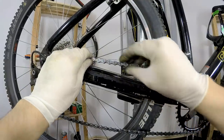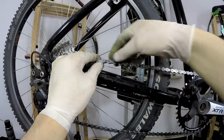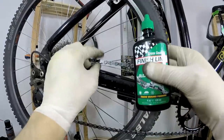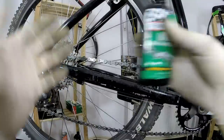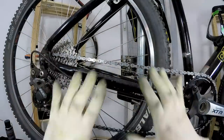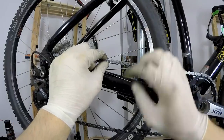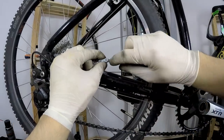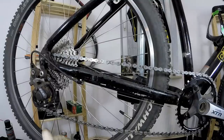You may use a neutral degreaser. But when you degrease your chain, you are removing all the microfilm of oil on your chain. Then the application of oil just one time will not protect your chain, so you'll have to re-oil it two or three times to once more really protect it against rust and dirt. My chain, as you can see, is clean now. There's maybe some dirt here, but it still has that oil film on the chain — and that's what I want to keep.